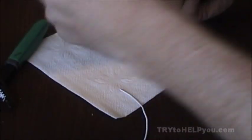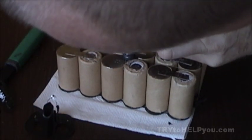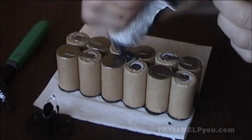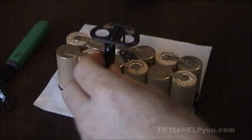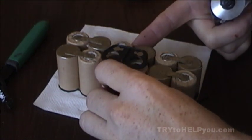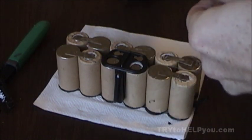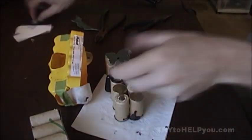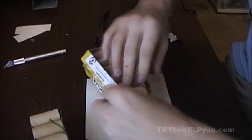Once that's said and done, put the cap back on — that little paper piece. You'll need to put some silicone in the center, just like it had before on the newer style pack, then put the plastic piece back in so it's all cased in silicone like it was when you pulled it out. I'm pretty sure it's silicone — it seems like silicone, but if it's not, I apologize. Beware: you're tearing apart a battery and doing this on your own, so take all precautions.